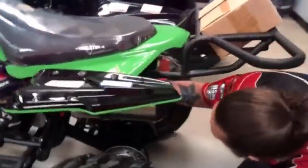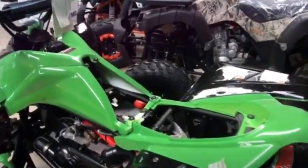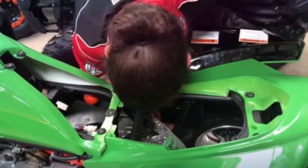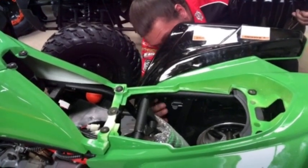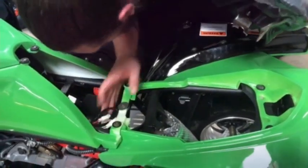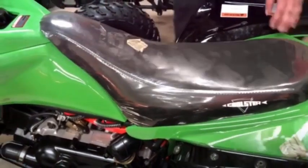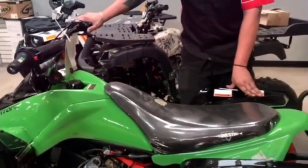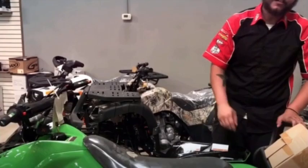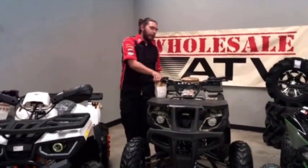On the back side there's a little lever — lift that lever up and it takes you to the other side where you can see the battery is underneath this fender. You should have a fuse running off of it into a little clear box — it's a glass fuse. If you're trying to start this model and no lights come on and it's not trying to start at all, that fuse is probably blown. There's an extra fuse inside that fuse box — just slap the new one in and everything should be good.